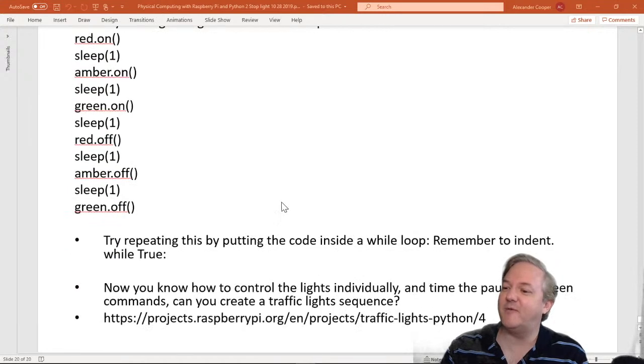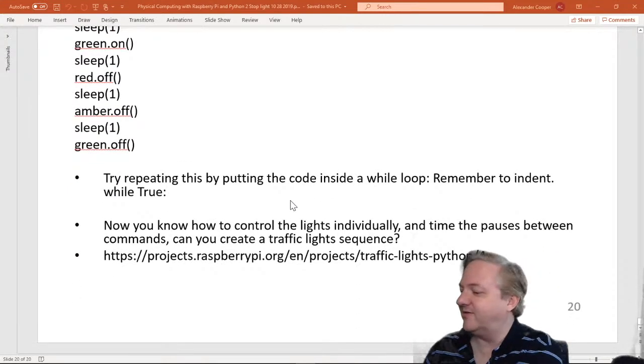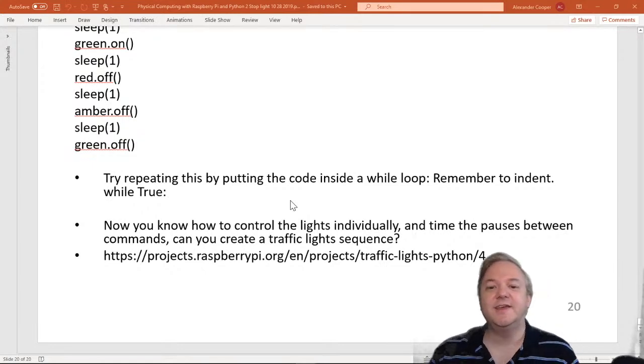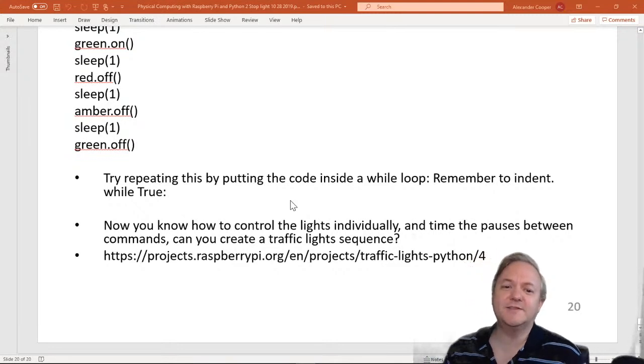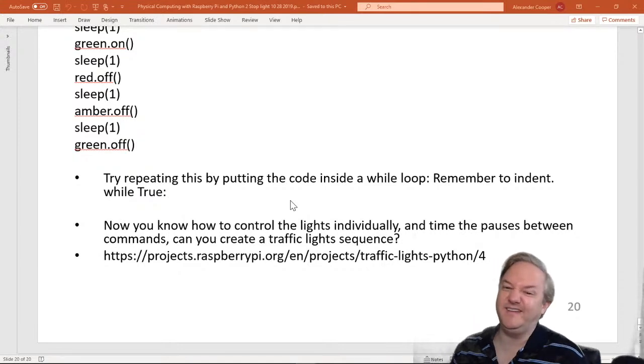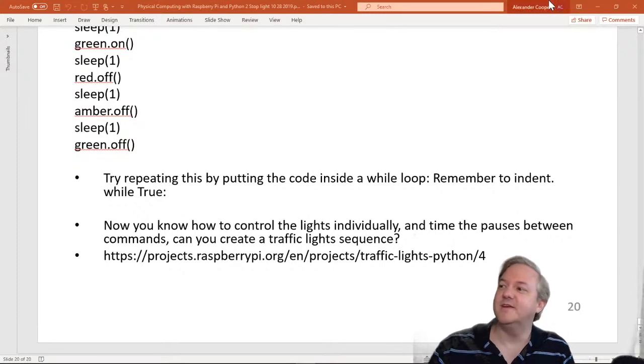So let me know what other projects you're working on. Like I said, I know we have covered a ton of stuff, but do realize we do all this as an all-day class, and this is just a brief overview to get you started and give you some ideas. It also lets you know about some of the pitfalls that I've had a few issues with. The best thing is to make sure that you get a good power supply for your Raspberry Pi. It'll make it last longer, and you don't want to overclock it too much for too long because it can fry it. Some people get big into overclocking, but make sure it's cool. If you do get into overclocking it, make sure it has a nice fan and you're keeping it cool. Okay? So keep it cool.